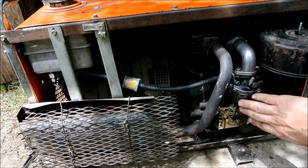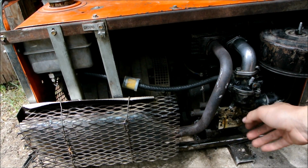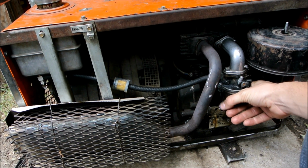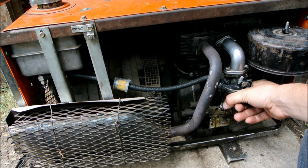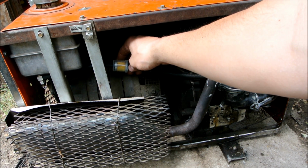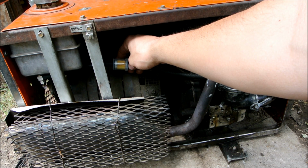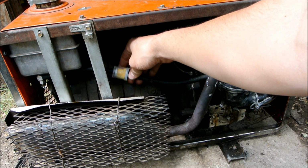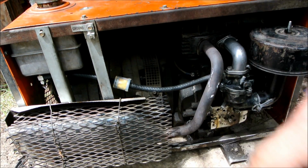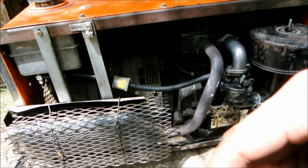We'll have to also figure out if it's boiling because of the carburetor getting warm, which I don't think it is. I can touch it, like I'm holding the carburetor, as you can see. I'm also wondering if it's from here, because it's pretty warm. I think it's just bubbling away there. So I guess we'll have to let her cool down.